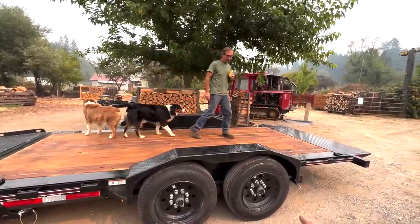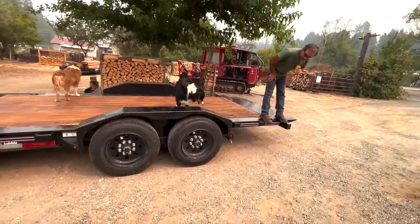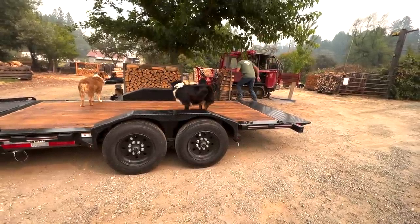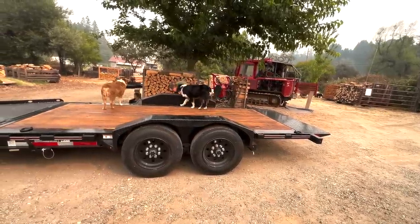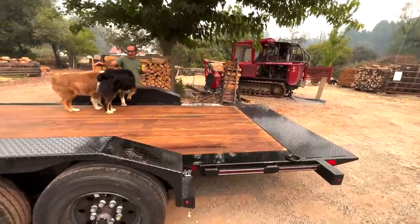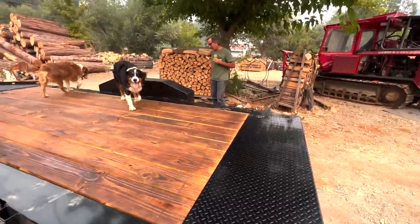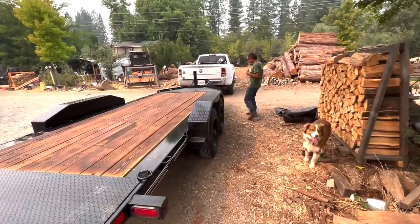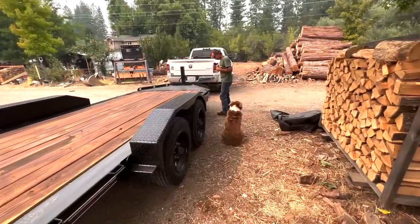It's got the 17.5 tires and wheels upgraded — I'm noticing you get better lug nuts with that too, the big bulge ones. They're not torsion axles, and I didn't know how I was going to feel about that. But for this particular trailer you can go to the 8K torsions. However, this thing actually rides really well having that equalizer, so I don't think he'll mind. You're not going to get that one-tire-while-the-trailer's-doing-a-wheelie-through-a-ditch kind of situation.